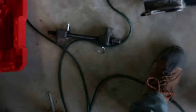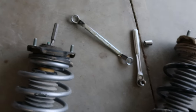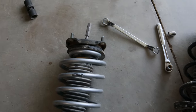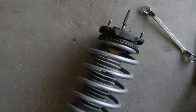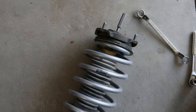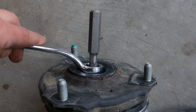What we ended up doing: once the spring compressors were put on, we had to use an impact to break it loose before using the wrench to finally take it off. There's just way too much pressure on there. If you can find a better way, better for you, but we did have to use an impact at least to break it loose. And yes, I am using a chrome socket with an impact. The offset wrench will just not fit in the cup.